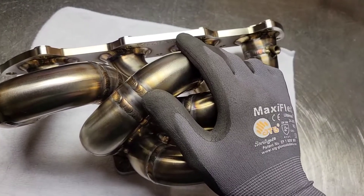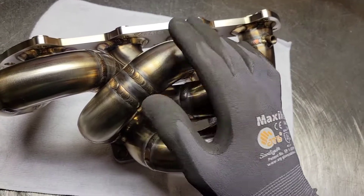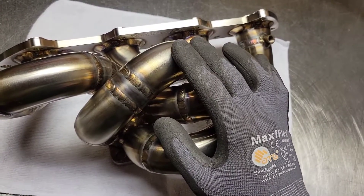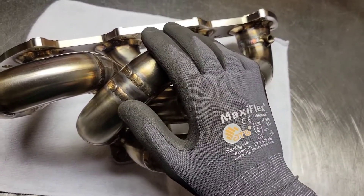This is how you make more power per PSI, and this is how you can reach the same airflow sooner without needing as much boost to do so. Less exhaust gas polluting the intake stroke — this is what we strive for with all of our turbo manifolds, and this is how we made it work within the stock flange locations.